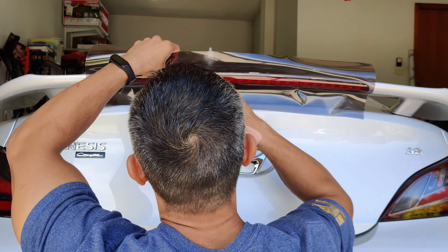The spoiler hatch closed on me, so I'm going to go back, pop the hatch, and redo this a little bit better. So again, going back to what I mentioned about trying to get a better angle — I popped the trunk so I can look underneath that line a little bit better, get better visibility and a better cut angle to make sure I don't slip and mess anything up. Finishing up on the right side, coming around the corner, then going along the gap underneath the spoiler and brake light housing — being careful to keep only the tip of my knife in that gap.